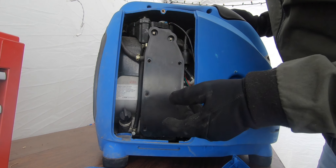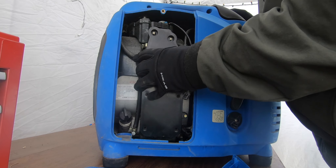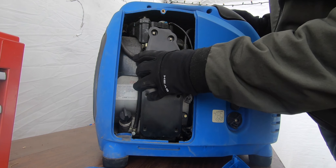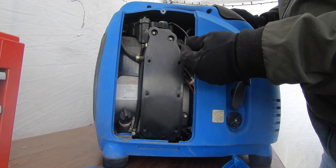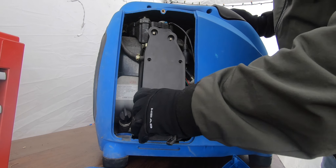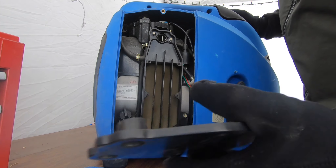This one, off camera, I already tried. It's a no go. What I think is wrong with this is what's wrong with almost every generator I get — the ethanol and gasoline goes bad. It goes really, really bad. After a few months it collects moisture and turns into this varnish-like material that clogs all the jets in the carburetor, so it doesn't spray gas and it won't start. And if it does miraculously start, it runs really bad.